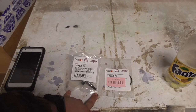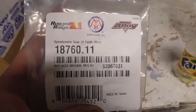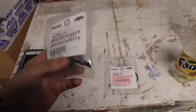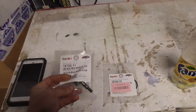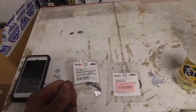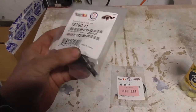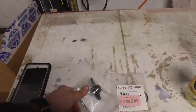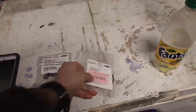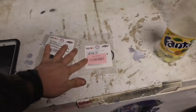I needed a 31-tooth gear, which is green — there's the part number. That's for 3.55s with a 32-inch tire. Because mine is a 2000, that is a short gear. Short gears are '93 to '06 and long gears are '55 to '93, so if you have a '93 you need to double-check whether you have a short shaft or a long shaft. The O-ring fits any of them from '55 to '06.